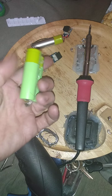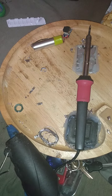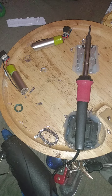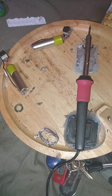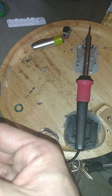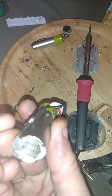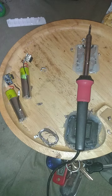These ones still have their shrouds — that's what they should look like. Know that when these are in use without their plastic shrouds, it will be a problem because lithium-ion cells actually have an electrified casing. The whole thing is electrified when in use, so you need to be careful not to have that contacting anything it shouldn't. All we've done is take glue gun glue, cover each place that needs it, and that's it. Now they're ready for installation.